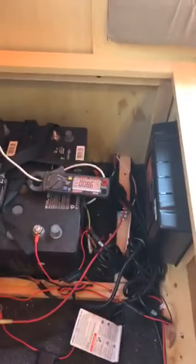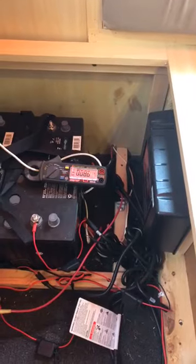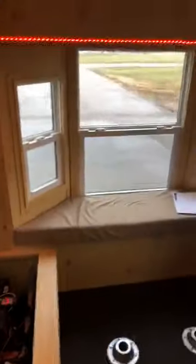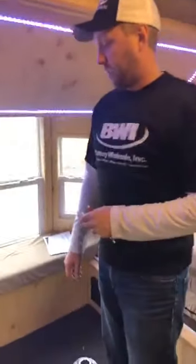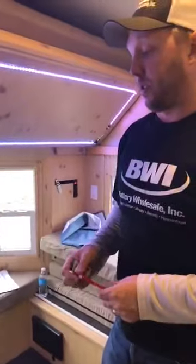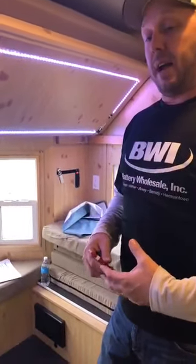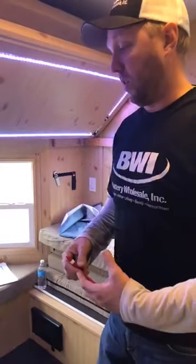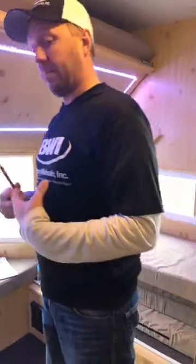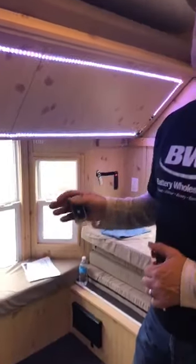If you look down at the gauge, just by me pressing that one button, I dropped a half of an amp. I'm down to 8.6 amps versus the bright white being up at 9.8. It's actually more than that. It's almost a couple amps that you're going to change. So right now with everything running besides my stereo, which like I said ran about 0.7, I'm almost at 10 amps running in this house.